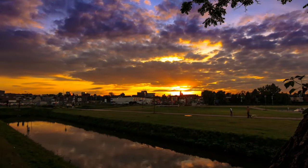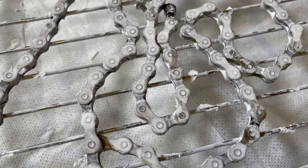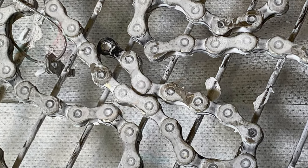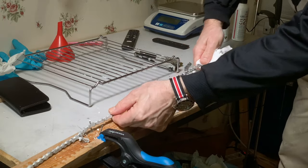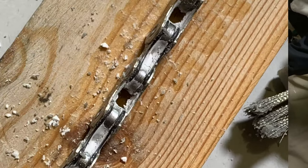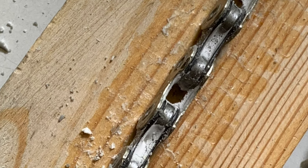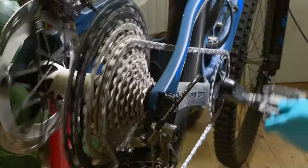Preferably leave it overnight. When the chain is completely dry and covered with a snowy layer of paraffin, it's time to activate link lotion. The basic principle is to smear out the paraffin in a thin coating that covers the entire chain. It's quite an easy job if you put the chain on a simple wooden board with some nails in it. Start with a rag and move on to wire brushes — we prefer soft steel, brass, and finally a nylon brush. Do not clean or remove the white bits between the links. They are needed to put an important layer of paraffin lubrication on the cogs of the chain rings. In other words, when you crank the chain, this job will be done automatically.